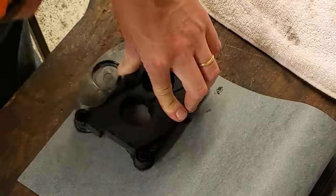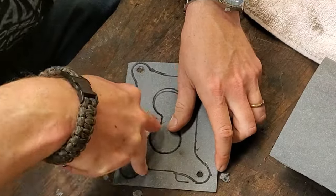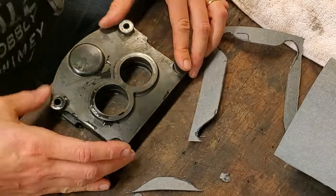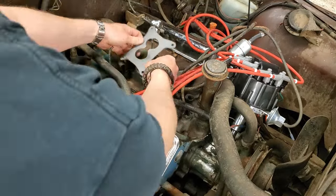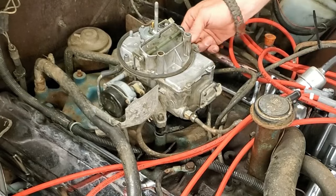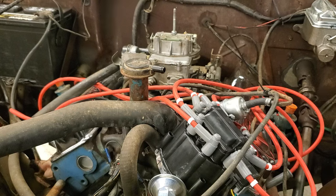The kit didn't come with a replacement gasket to go between the spacer block and the intake manifold, so I had to buy some gasket material and make my own gasket. You can see me using a little bit of water to mark out where the holes need to be in the corners and mocking up what the gasket would have looked like — the original got pretty torn up when I pulled it off the engine so I couldn't just copy it. Then you get the insulator block, and there's actually another insulator, and then the carburetor goes on top. You can see the automatic choke on the side close to you — there's a heater hose that runs right by it and that helps it warm up.